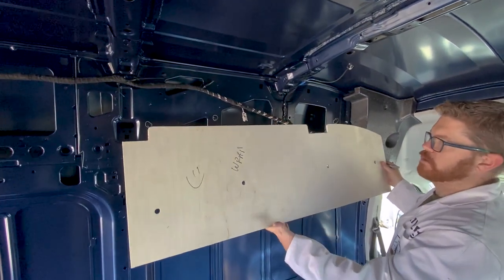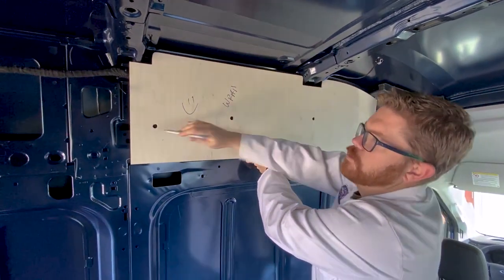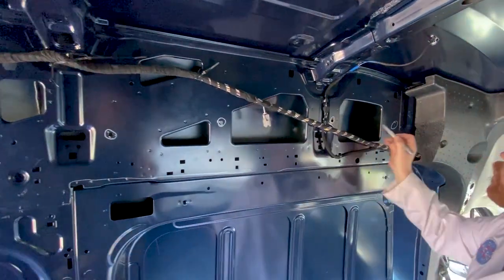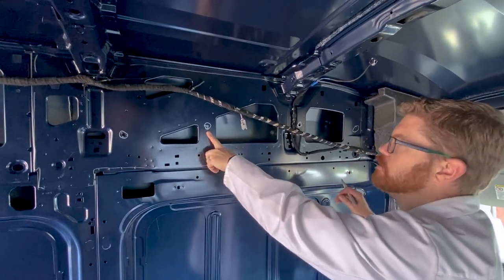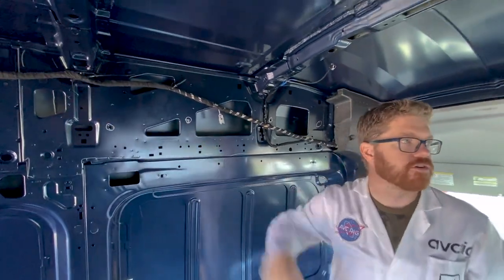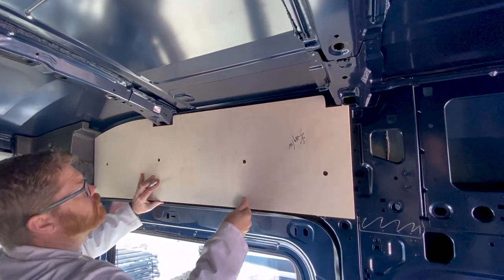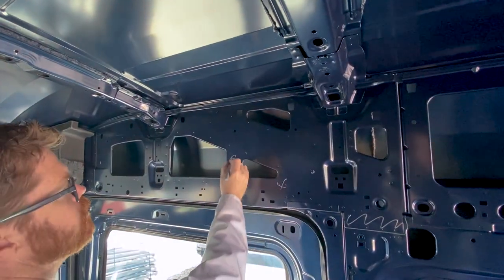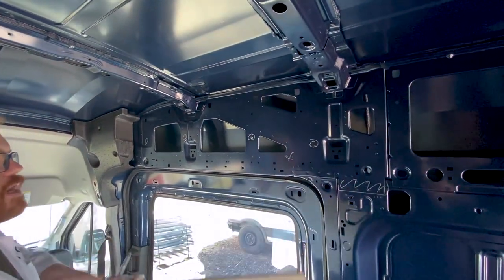Now that our foam blocks are trimmed, we can do a quick rough test fit of our upper driver's side panel. This upper panel slides in place and we use a Sharpie to mark through which holes are going to line up. We can see these four holes are going to line up with corresponding holes on our panel. These will fit a 1/4-20 rivnut without any messing around — pop one in and we're going to bolt this panel up, which gets us around that hardened material. Same thing happens on the passenger side.